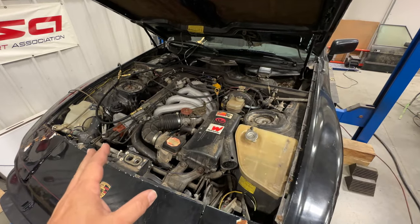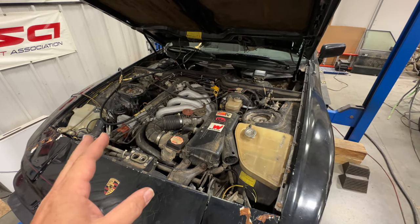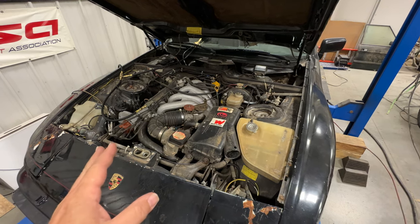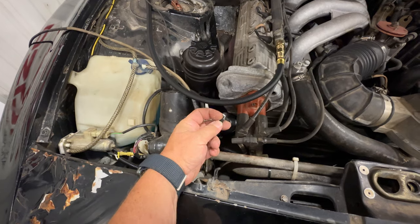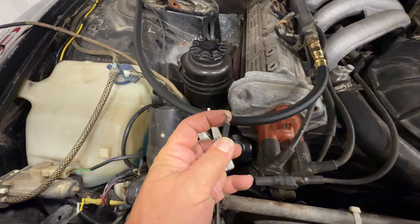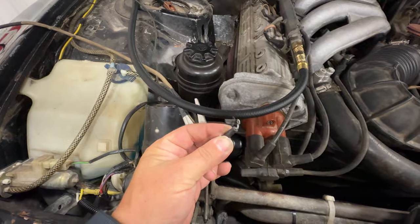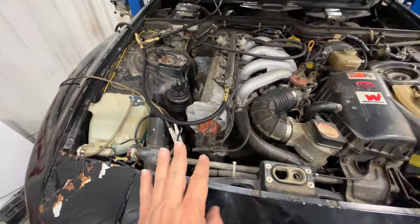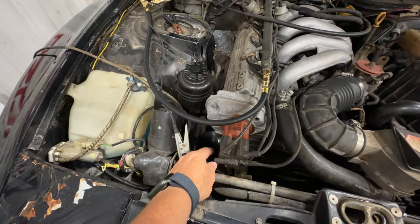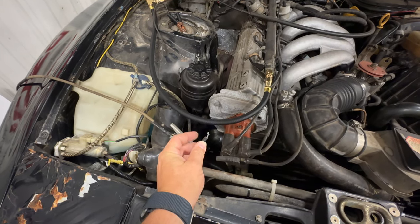That was very interesting. I started the car up and then did a final check to make sure everything was okay. And then the minute that I turned on the parking lights so that I could see the gauges better, the car died and it wouldn't restart. Look at this — the wire from the coil to the distributor just came apart and it's super, super corroded. So could this have been my problem all along? I need to replace this wire and then probably keep testing. It could have just been vibrations causing my lack of power at the rally cross.